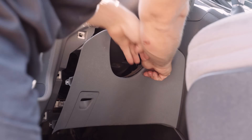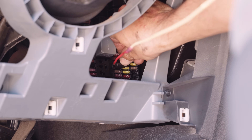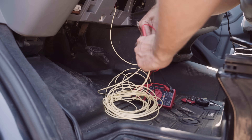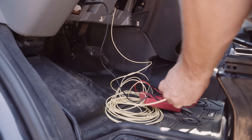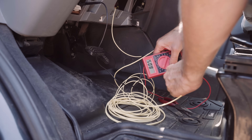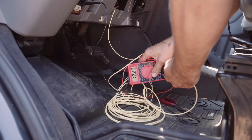Now I'm accessing the fuse panel under the steering wheel in our Ford Transit. What I just did with that wire that I measured out and cut was crimp it onto a fuse tap, because this is the wire that is going to control or switch on and off the ACC or accessory-controlled fuse that I'm going to install in the battery box. This is what will be switching anything in the box that I want connected and powered only when the engine is on. To ensure that this is working correctly, after I put the fuse tap in, I grab my multimeter and simply test when the engine is off, and then I switch the vehicle on and test that wire again.